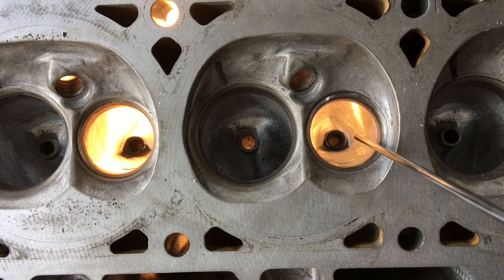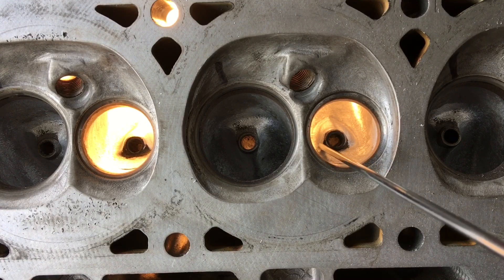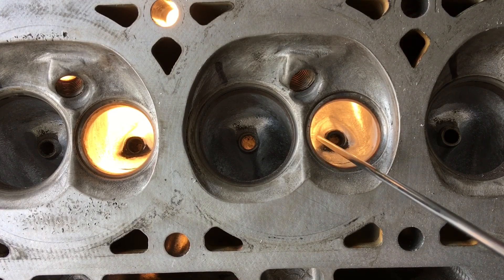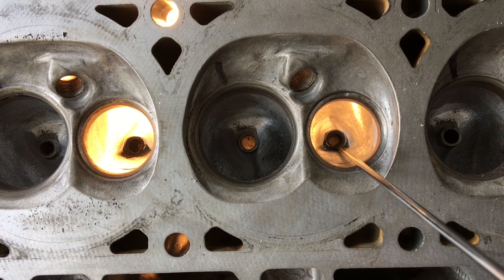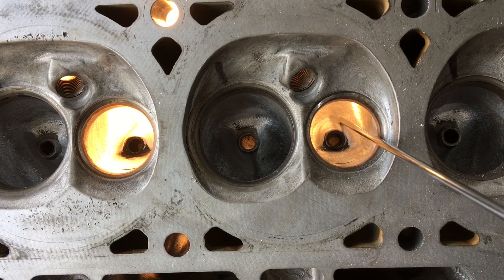What you're looking at is this back wall. Think of air coming down - it's going to hit the valve stem, and the natural rounded shape of the valve stem is going to direct the air to each side. All you're really trying to do is remove material on each side of that rounded surface to promote airflow. The air comes down, hits the valve stem, and turns left or right - so those side areas are where you're going to gain your flow.